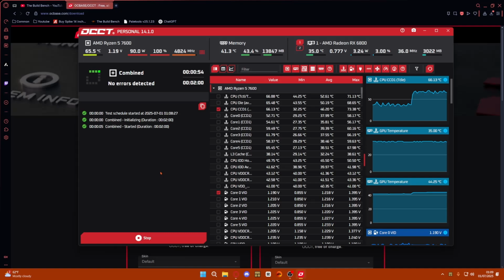You run it on normal, you run it on extreme. If you don't get a blue screen, then the memory's fine and the controller's clearly capable. So that's why I don't mind running an extreme test, especially on the memory. But again, as you can see, we're like halfway through now and it's not detected any errors. Even the temperatures are fine,